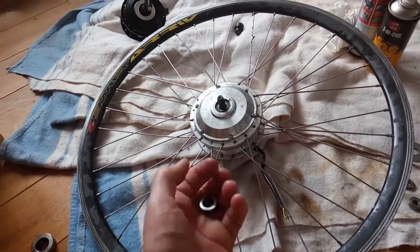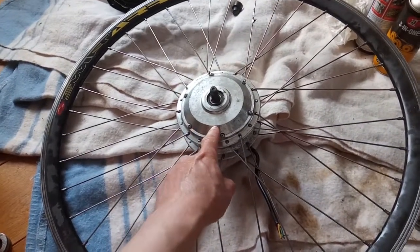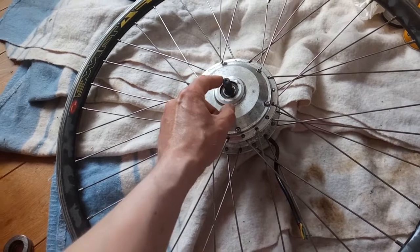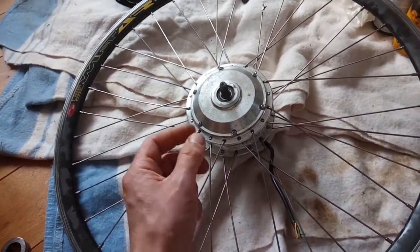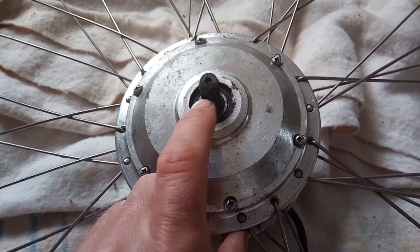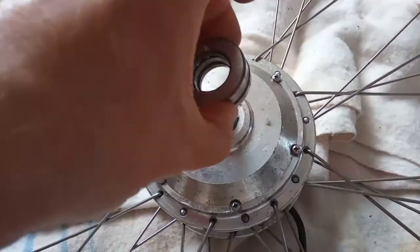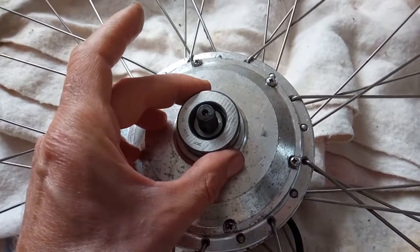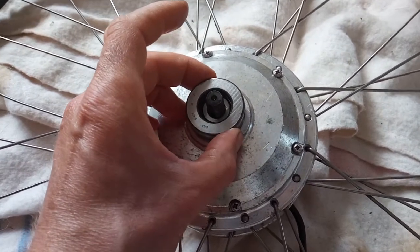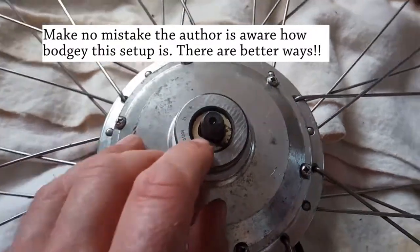Because this wheel is going to be used in a kite turbine, there's going to be a lot of force coming this way from the rim onto the casing, which we have to hold on the shaft. These little bearings - because there's nothing fixed on here, it's just the shaft that's holding this back from popping out that way. It would take an awful lot of force to make that happen, but it comes down to this bearing here. So what I've decided to do is make a little ring, a spacer, and put on a massive big axial thrust bearing, and that should help hold the casing back. It sits on the casing with a little play from that bottom spacer I've put on, so I've got room to fit in one of those slotted washers.